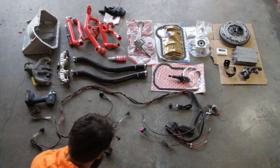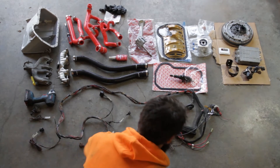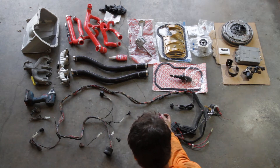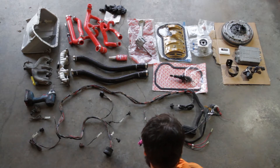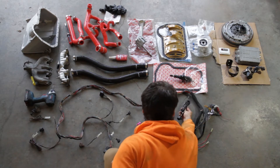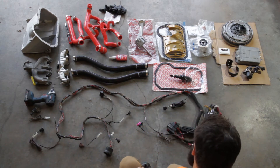All this stuff is stupid easy. Seriously, it takes about two minutes to hook it up to the engine. The harder part will be hooking it up to the van, but I'm still not worried about that much. This is your OBD port. He even has a cool little 3D printed TDC thing on there — his company has TDC. And that has a nice long cable so you can put it in the front of the van. And then over here we have — I think this is the, yeah — this is the speedometer cable. I'll talk about that in a second.